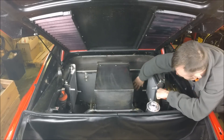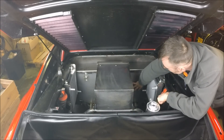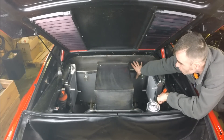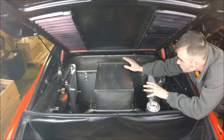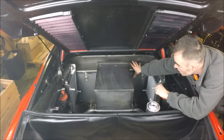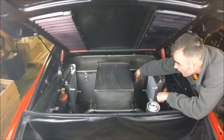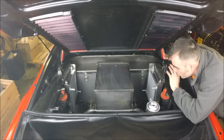We've got the main battery box sitting nice and low, down on the chassis rails. That's the main battery box — we've got about ten batteries going in here, about 25 kilowatt hours worth. It's nice and central to the car. On performance conversions, we always try to make sure the weight distribution is at least as good, if not better, than the original. The idea is to put the battery box just behind the seats, forward of the rear axle — perfect weight distribution.